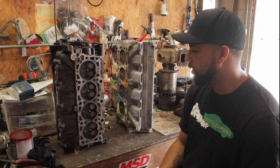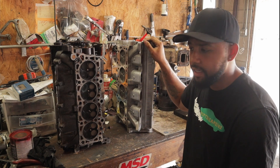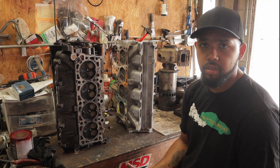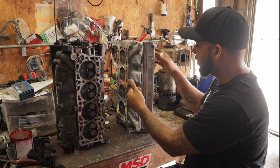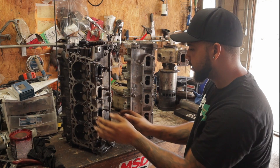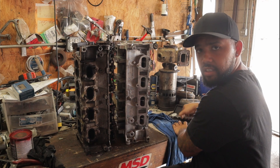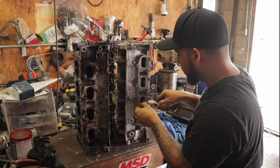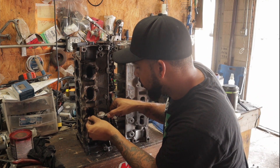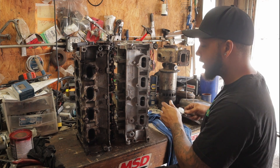Hopefully swapping back to the C head will get us the fuel mixture the C head motor is looking for. I'm swapping the heads, opening up the ring gap on my piston rings, and we're going to run some boost — though not right away. After the issues between the two motors, I want to put it back in naturally aspirated first, see how it runs, and once it performs well we'll start fabricating a turbo kit. I'll also verify the exhaust port measurements with calipers — I'm getting 1 inch 200 thousandths on the C head and 1 inch 100 thousandths on the B head, so extremely similar, though the difference could be from carbon buildup.